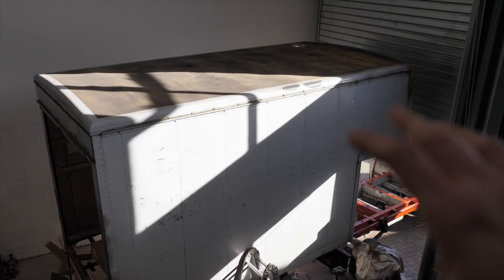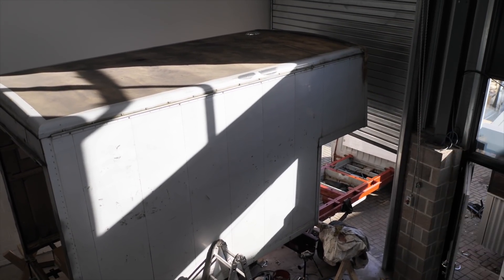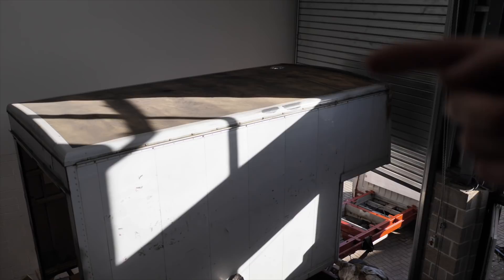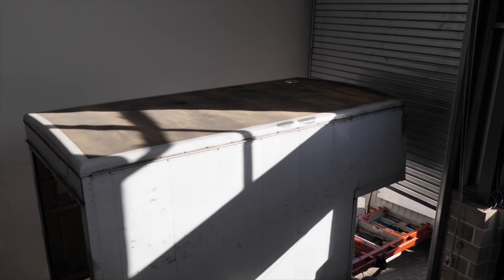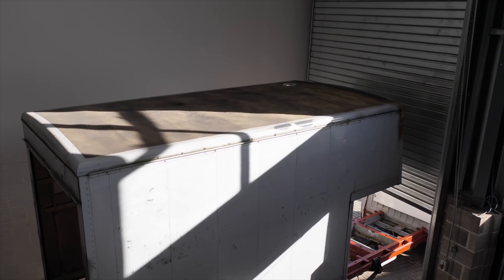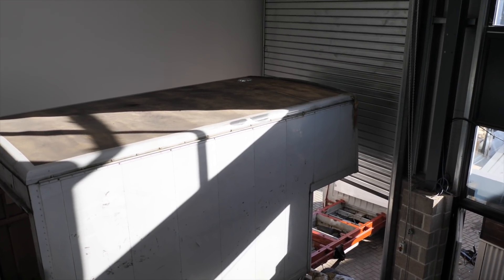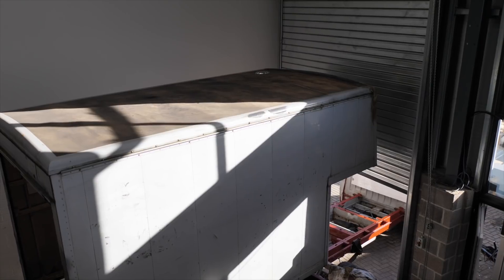It's bizarre having the box off in the workshop but it's going to be really fun. The Luton box that was on Ben's van has a front part that goes above the cabin, but only just above the driver's compartment. The top and front face were all fibreglass, and we're planning on getting rid of the whole fibreglass roof because it's cracked with holes, and getting rid of the fibreglass front entirely. This whole front is going to be extended out and supported on two steel rods going all the way down through the bumper to the chassis.